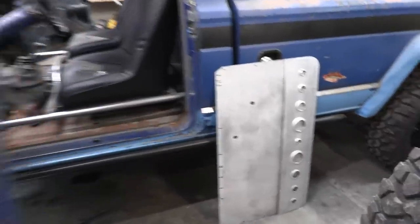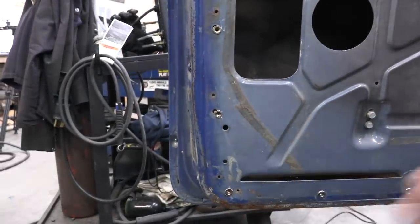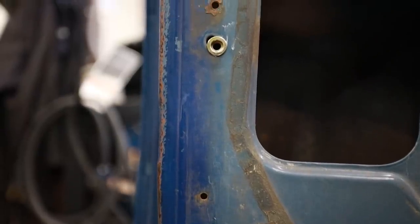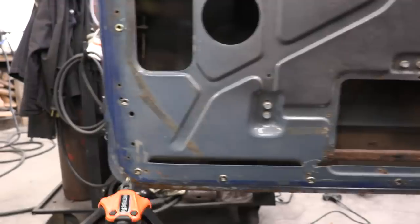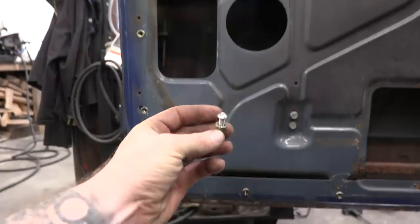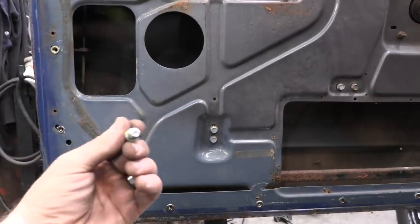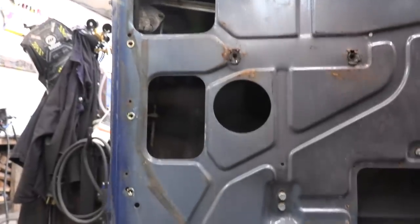This project is humming right along. I'm about to mount this door panel completely for the first time. What I've done to make it mountable is put these things called rivnuts in here. You use this tool, drill a hole, push the rivnut into the hole, and when you expand the rivet it gives you a place to mount quarter-by-twenty hardware. I like quarter-by-twenty stainless steel hardware — I use this stuff a lot because I like the look of it, and this is going to be what I use to secure the panel to the door.